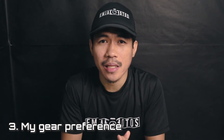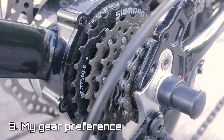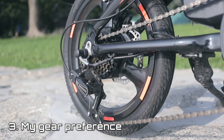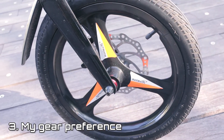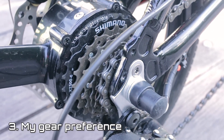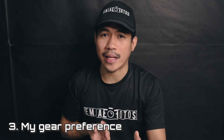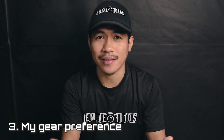Number three is the gears. It comes with Shimano six-speed, but in reality you don't really need those gears — the majority of the time you're using it as an e-bike and not shifting. You only need them if using it as a normal bike or if you've run out of battery. Based on experience when I did run out of battery, given the 16-inch tires, 19-kilogram weight, 40T chainring and around 14T lowest cog at the back, you can't go very fast. Personally I'd trade the six-speed for a bigger chainring upfront as a single speed for more flat-surface speed.